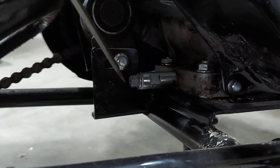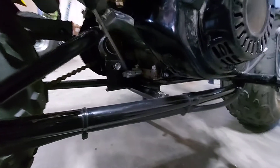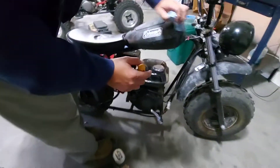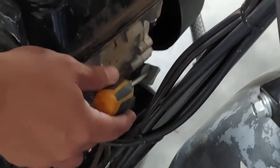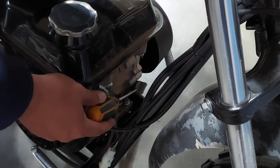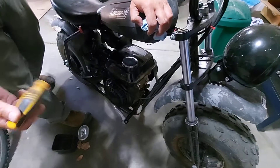The reason I suggest doing it now is A, you need to do it anyway, but B, when we go back and fill the oil — because we just shot half out the spark plug hole and we don't know how much was left — so we drain the rest out here. Put the drain plug back in, and right here is your oil filler tube. This does have a gauge so you can see how much oil to put in — it goes pretty full. Whatever the book says, you can just eyeball it. Put that back in. This is all just to deal with the hydro lock.